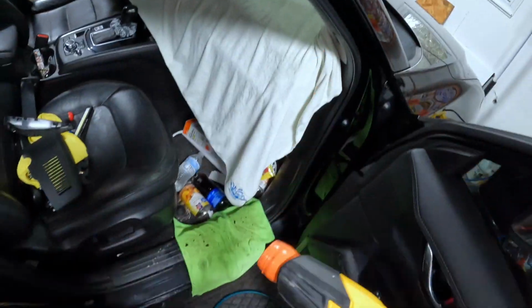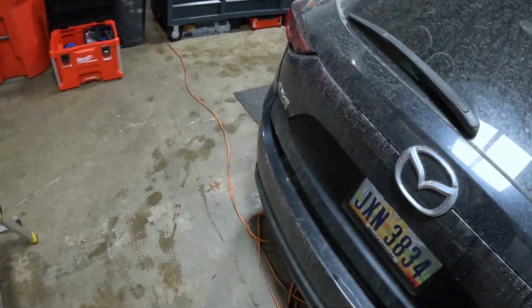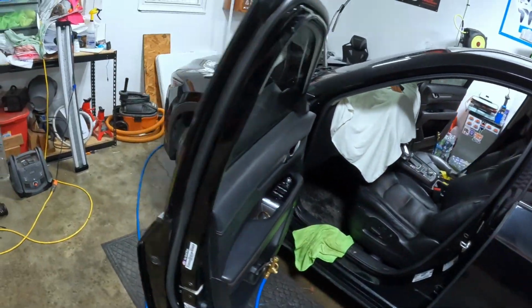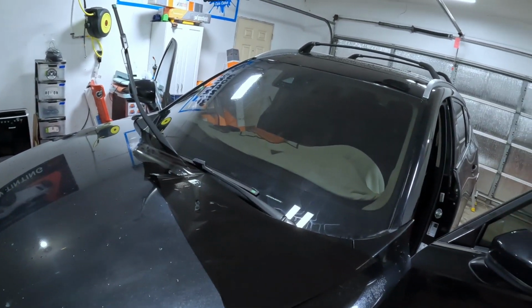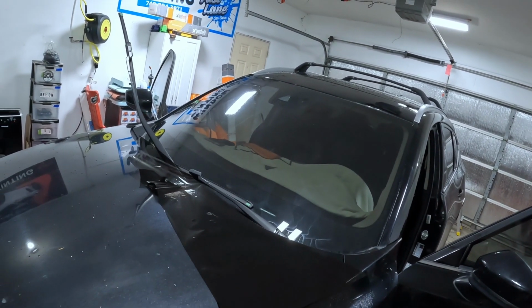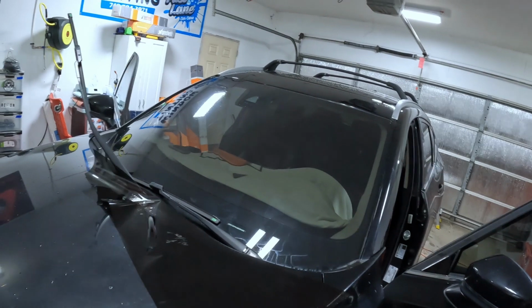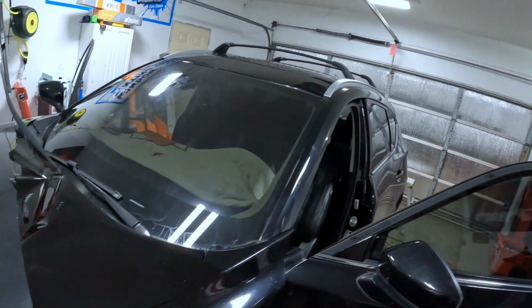There you guys go. That's how I use Glass Aid on these cars. And like I said, pretty good product. You can get it all kinds of different places. I'm sure most of you probably already heard of it. We're not going to do the full install and all that stuff on this video. I just wanted to show the Glass Aid, and how it's not just for being able to see your cutout line, but also for protection of the glass, because even if you have name brand blades, sometimes they will scratch.